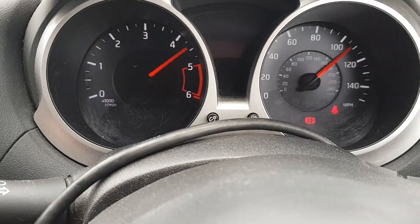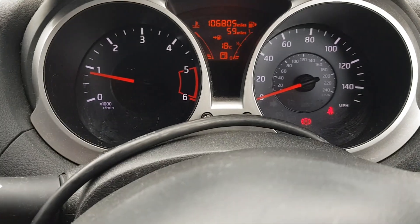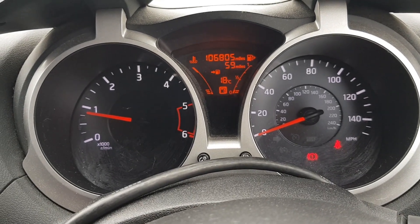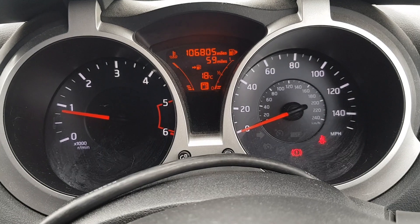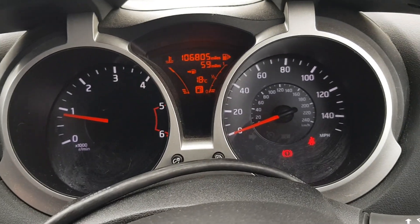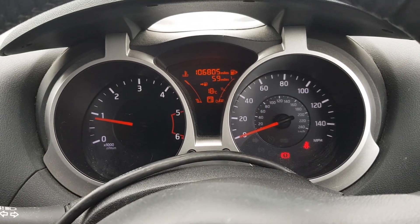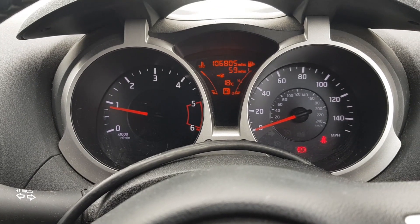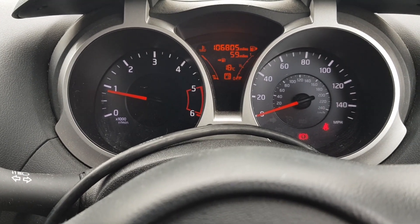Battery light on and back off. As I say, it hasn't played up on a drive or anything like that, and there are no other fault codes. So I think for the battery light issue, we've got that fuse blown. It's a bit of a shame — I don't know exactly why. Apparently a car was jump-started off this with a set of leads, so there could potentially have been a mishap there, and it has had a new battery put on it. There may have been an issue with the charging rate previously, but it seems all good at the moment. We're going to drive this one on and monitor it, and we'll inform the customer about the DPF fault and see what they want to do. Cheers guys, see you for the next one.